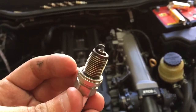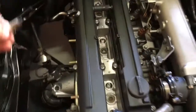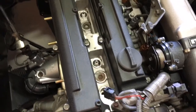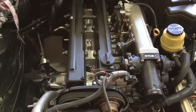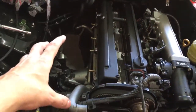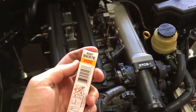I'm planning on running a fair bit of boost in this, so one of the things you'll find is that spark plugs are a bit of a hit and miss — pardon the pun. You'll find something that's happy with the amount of boost you're running, the fuel you're using, the ignition system, etc. I've got a TO4Z on a highmate manifold going on here, so I'm just going to be putting in some cheap standard copper cores. The weapon of choice everyone seems to use is BKR7Es.